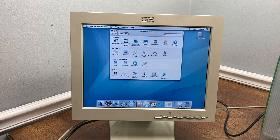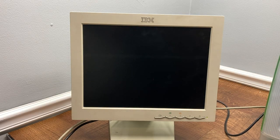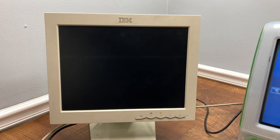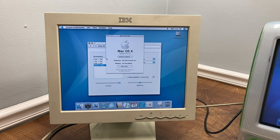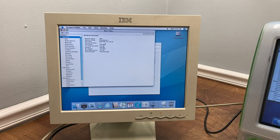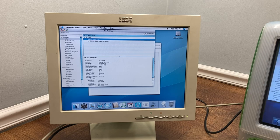Can we readjust the resolution of the internal screen to be something a little more pleasant? 75 Hz. We don't have an option for 60, which I thought we might. I could go down to 640 by 480 and force it to 117, but that's still not very nice. I'll set it back and use the external screen for now. So it booted — that's surprising. It looks like a pretty default macOS 10 install; it's running Tiger. Holy crap. Did not expect that. We've got 768 megs of RAM, which is quite high for a 400 megahertz iMac G3. Sounds like that hard drive is most likely the stock hard drive — let's see. We have a Maxtor. It is not the original hard drive, so this thing has seen some upgrades. This is a 30 gig Maxtor drive.